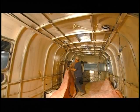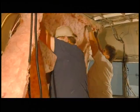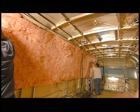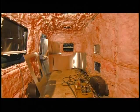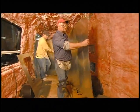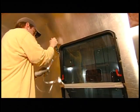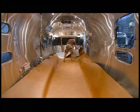Next, they apply a water-based adhesive to the interior and install insulation throughout the shell. They bring in the interior skin — the same aircraft-grade aluminum used on the outside — trim the walls for the window openings, then lay down the vinyl floor covering.